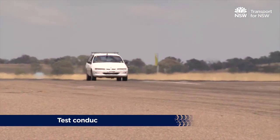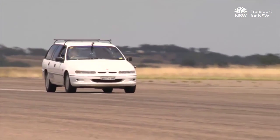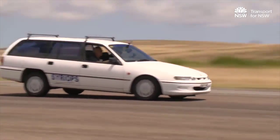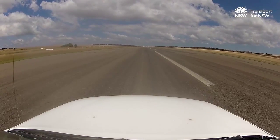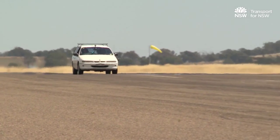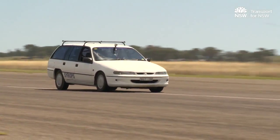The spike stop test applies sudden and instantaneous load to the vehicle to test the function of the brake components under duress. The test is performed at 55 kilometres per hour in neutral. Ten stops are required if the vehicle is lightly loaded, or five stops if the maximum loaded test mass is used. Care should be taken not to lock the wheels during this test as that can damage the tyres, and the test should be repeated if the wheels lock during testing.